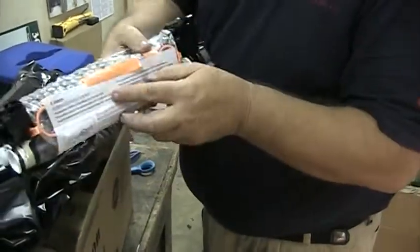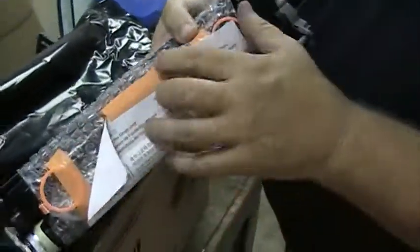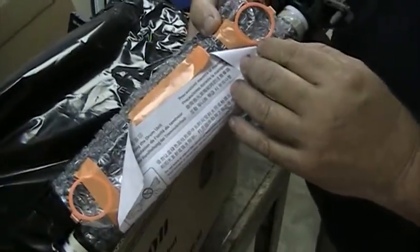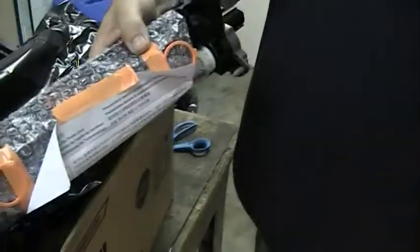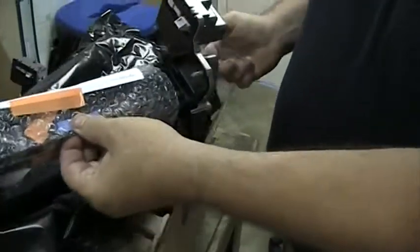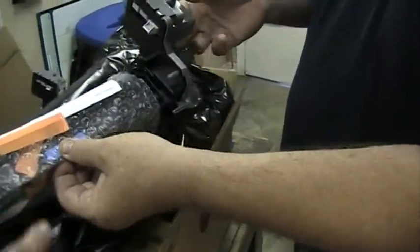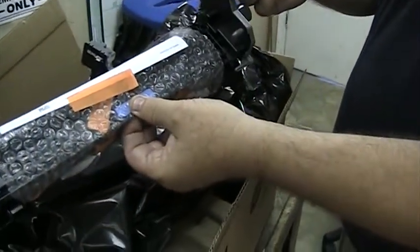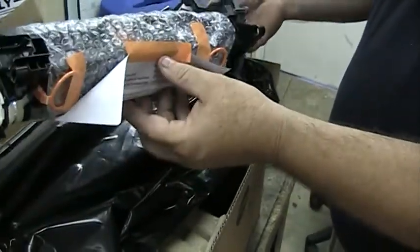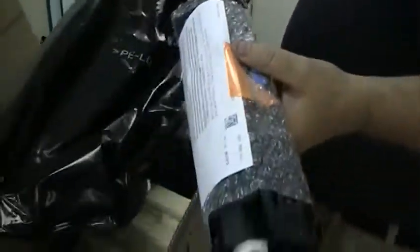It'll come wrapped in black. Take off all the orange tape and you'll notice these two handles right here that look like loops — you need to get all the plastic off and pull those two units out. They'll be a little stiff. Make sure you're always holding the drum with your fingers on the frame, not touching the actual aqua drum surface. Then slip the new one back in.